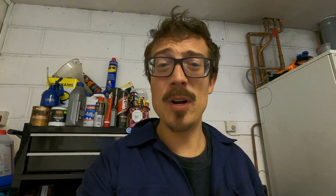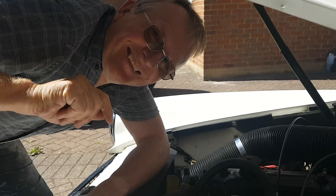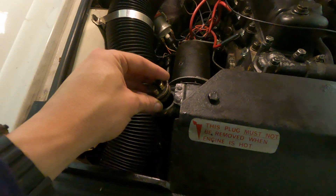Fun and games. So what do we do? Option A: buy a brand new radiator and fit it. Option two: buy a second-hand radiator and fit that. Or number four: try and fix it myself with the help of Dave. Let's take a look at Dave. The option is to try and put this back in there by soldering these two bits together. That means I have to take the radiator out, which means flushing the whole system, taking off the front grille, removing all the hoses, and then removing the radiator and cowl. Not done this before — it's going to be an exciting adventure. Let's give it a go.